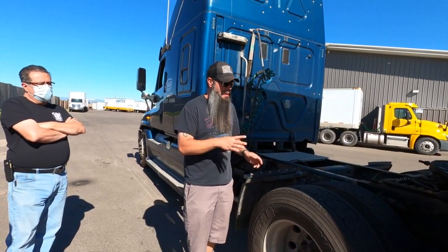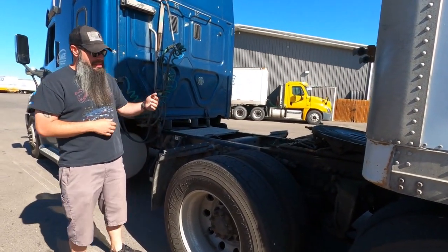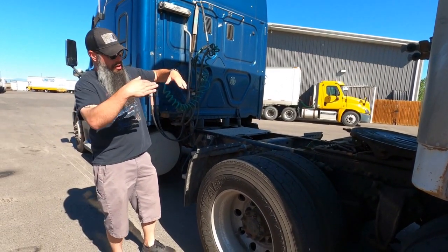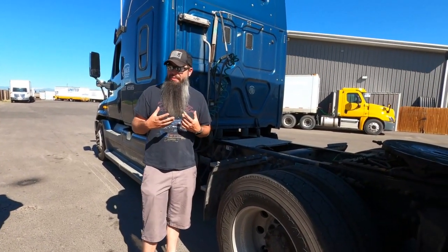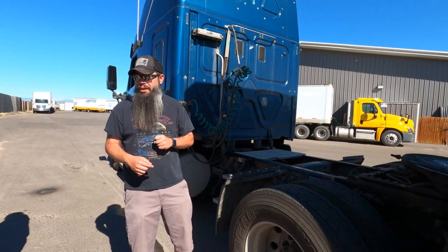So this is a good way to stop and look and make sure that you're at an appropriate height and distance for this hookup. In this case, we are, so we can see that the trailer, fifth wheel skid plate, and the trailer are going to skid up together, which in turn is going to make sure that kingpin is locked all the way down in the fifth wheel. And what I'd be inspecting after that is to make sure that there's no gap between the skid plate and the apron, okay? That's another warning sign that you're not fully connected.